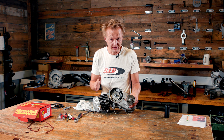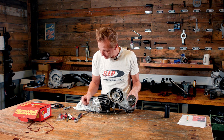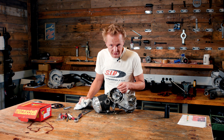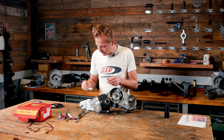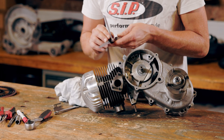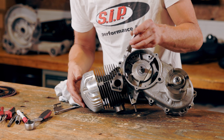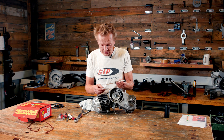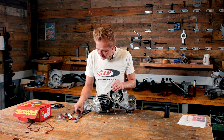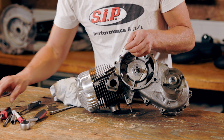This is the only way that the piston can open and close the intake port. The intake port is quite long and it's hard to see inside. Our measurement tool, the feeler gauge, is not fitting very well — either I cannot measure the exact value or I will destroy and bend the feeler gauge. So in this case I'm using a little steel wire and applying it to the intake duct.